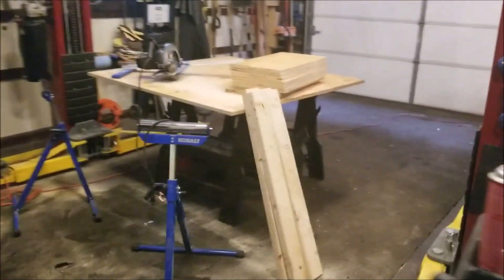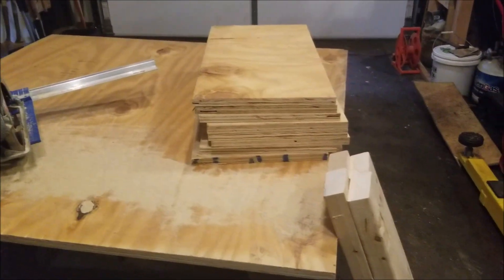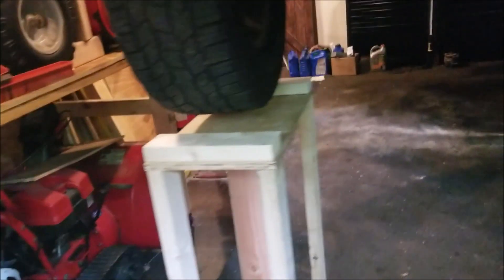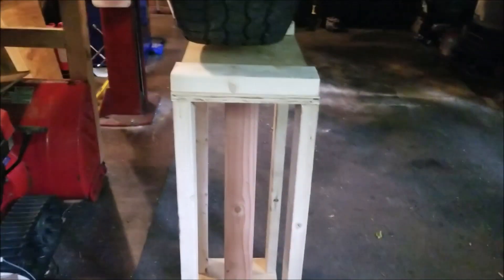Okay so these are all your pieces basically cut up — I've got some more on the other side of the shop. Now it's just a matter of putting everything together. The final step is putting a 12-inch 2x4 on the other side and screwing or nailing it down — I glued and nailed mine with a couple screws to follow. That rear stop piece prevents the vehicle from rolling back off the stand. Safety first: absolutely make sure your parking brake is on and in working order before you attempt this.